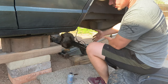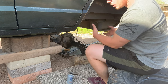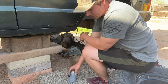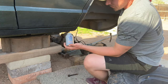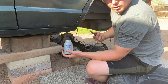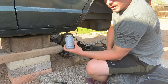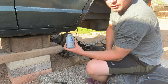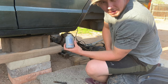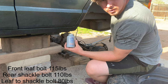After the paint is dried on your axle, it's time to bolt in the new leaf spring. To make removing the bolt that goes into the body easier in the future, put some anti-seize on it and torque it down to the recommended specs. I'll put on screen the torque specs they suggest for this front bolt and for the rear shackle bolt.